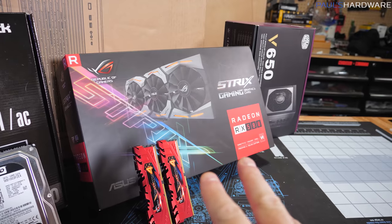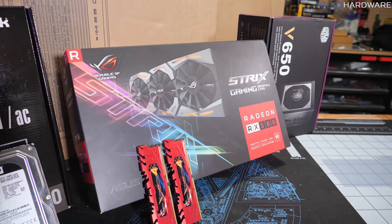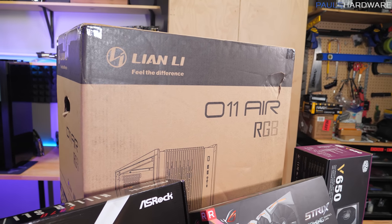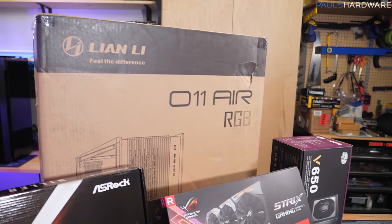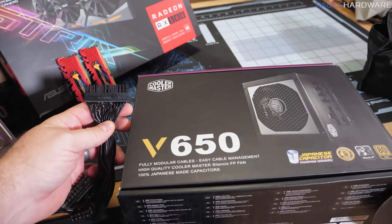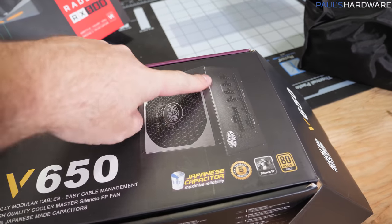The graphics card could be upgraded too — this is about a $250 card; also consider the GTX 1060 6 gig as another good option in this range. To level up from here you're probably spending about $400, so I wouldn't consider that for now. For the case, stick to about $60–$70 — there are many options like the NZXT H500 or Phanteks P400. For the power supply, my requirements are 550–650 watts, 80 Plus Bronze rated or better, with all-black cables if possible.